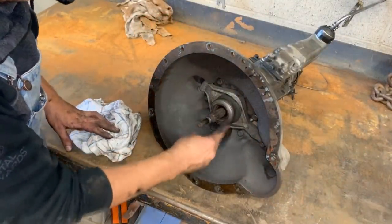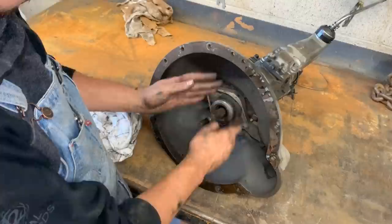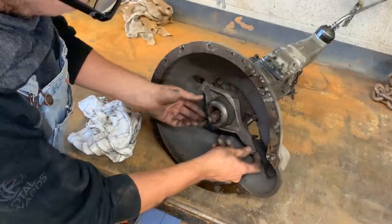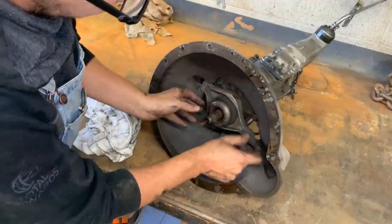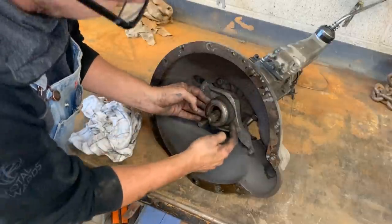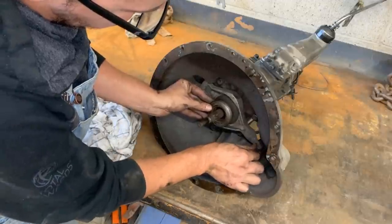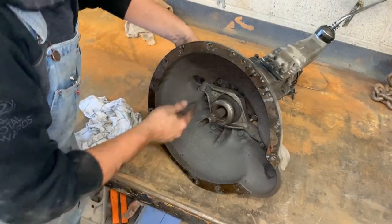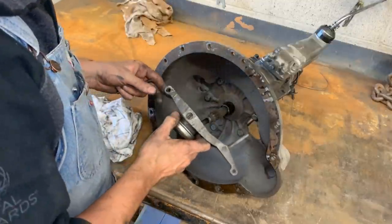Okay, I don't see anything wrong here. The bearing can make some noise, but there's no play or anything. It travels well. It swivels here on these 2 pins, which it is supposed to, because if it doesn't swivel, then it would be a problem. When it goes too far, of course it hits, but this is how much it travels, you know. It doesn't travel more than that, so it swivels well. This pin here at the back, we're gonna have to replace anyways, because this is ridiculous.